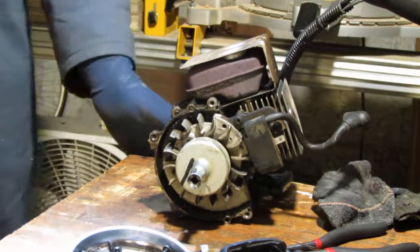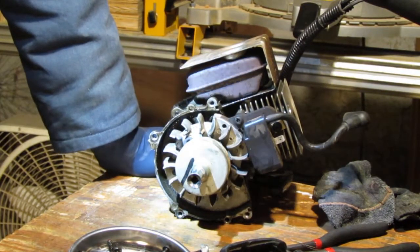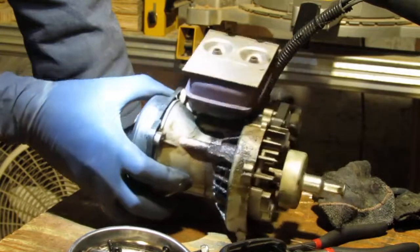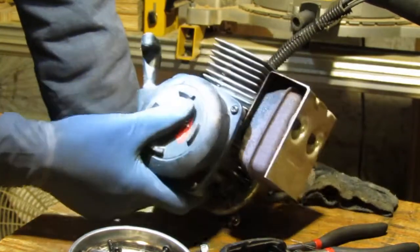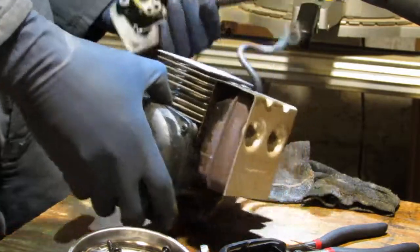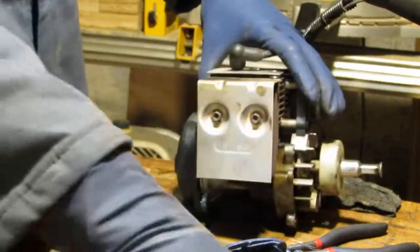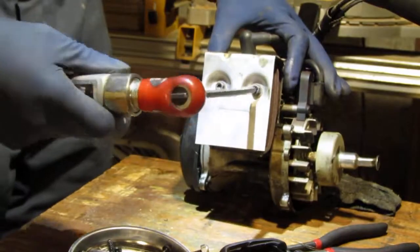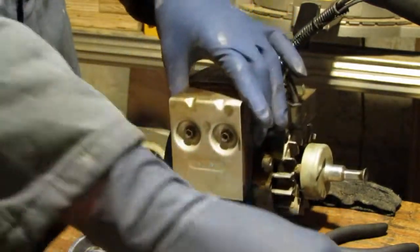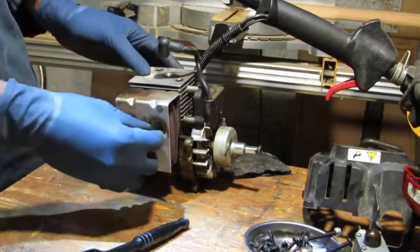I gotta get some specs on this motor. We know it generates sparks, so that's good. Also know it's a leaky mess. The carburetor is a giveaway, but I don't understand why it would be so leaky on the exhaust side. Yeah, let's get that exhaust off and see what we get, shall we? I have a feeling it's not the right size. Yeah, it's too big, too small. So this is 5/16.